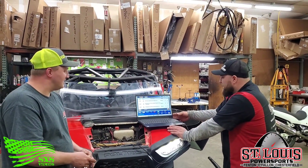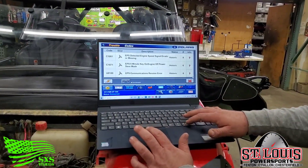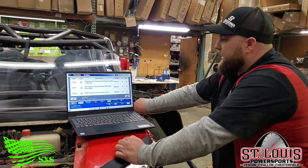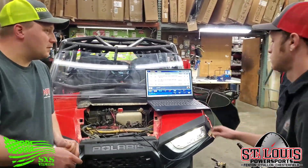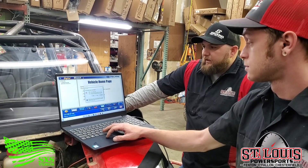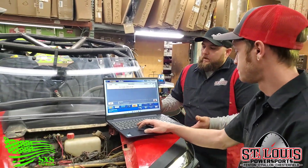We now have all of our trouble codes pulled up here. Looks like all of my issues are due to the EPS having low signal. My machine did sit for a little while before I got a chance to get it out over winter, and I did have to use a jump box on it to get it going — so that could be the cause of most of mine. I'm going to have Colton show how we can erase these historic codes and see if they stay off. They cleared away — okay, so in this case we were able to hook right up and clear the codes off.